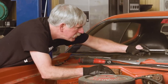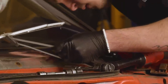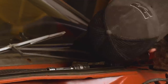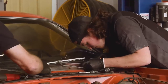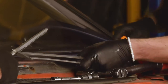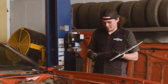Underneath that arm is a little clip. Back here? It's right underneath, on the bottom, underneath your left arm. Oh. Underneath. See that little tiny clip right there? Oh, yeah. Do you still have that pick? Yeah. Lift up and slide it sideways, possibly? Oh, that was sweet. I think you got it. Now you just rock the whole assembly up and down and pull it off there. Beautiful. There we go. That's the easiest one you'll ever take off.